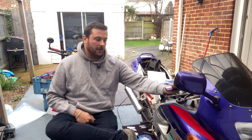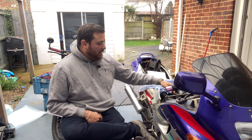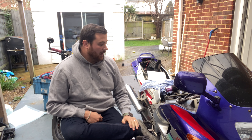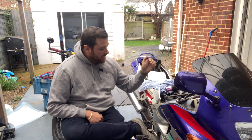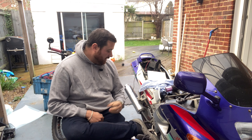The fuel pump was continuously running, making fuel drop out the bottom and putting too much fuel in. When it was running it was kind of okay, just didn't sound great. But when you were just trying to start it by turning it over, you could see it was puddling in number three. If you opened the throttle you'd put all that petrol straight into the engine and essentially hydro-lock it. When you let it sit, fuel goes down into the sump - that's why the oil level is too high.